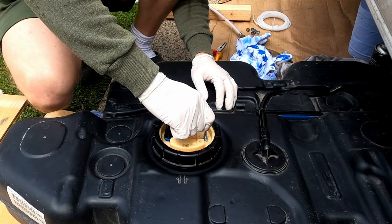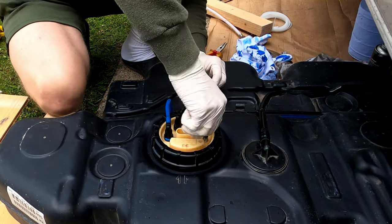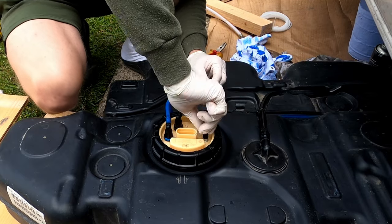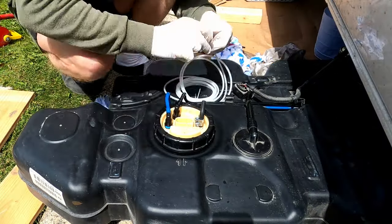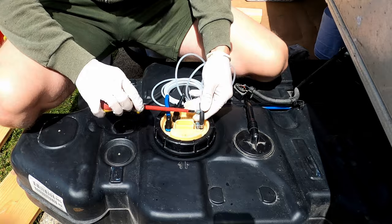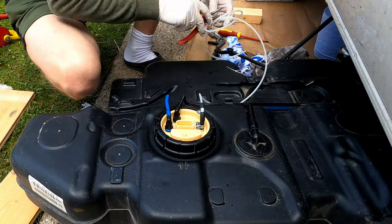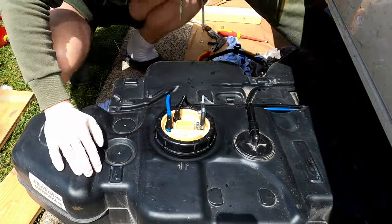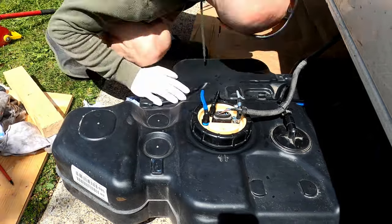Now it's time to attach your fuel line to your fuel standpipe. Just make sure whenever you insert this white nylon fuel line into a black hose, you insert it all the way in. Because apparently if you don't, air bubbles can get trapped in there, and then it will create all sorts of problems. Just run your fuel line along the existing fuel lines. Your fuel tank has handy spare clips in there.